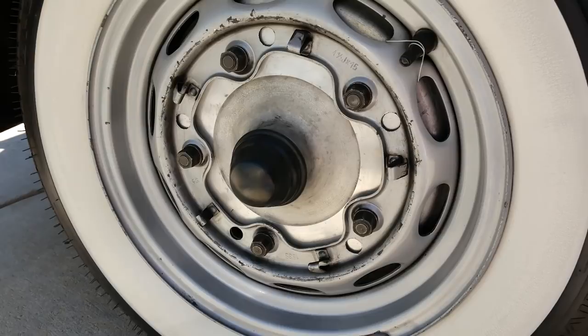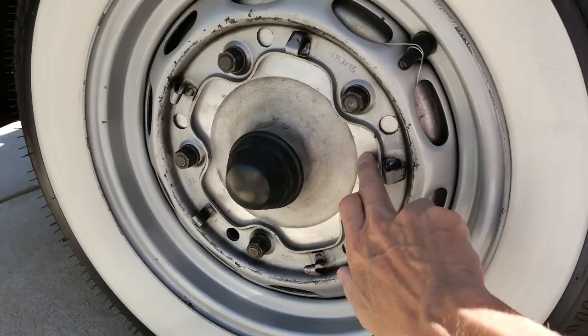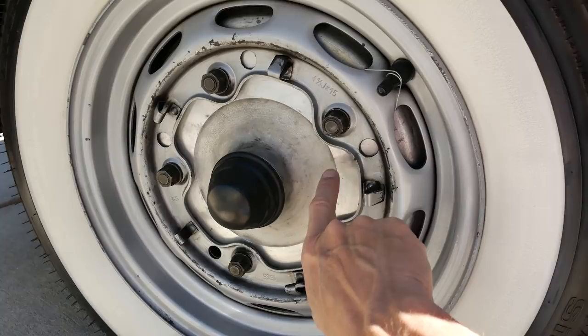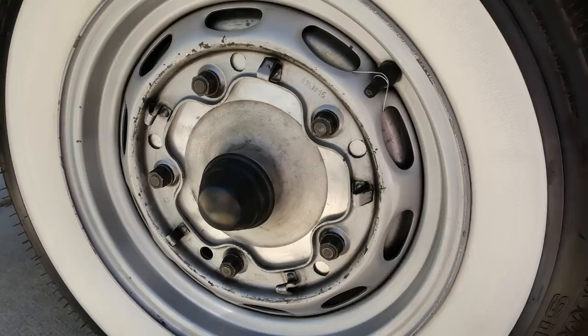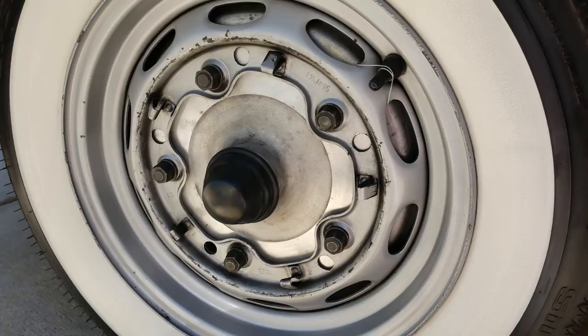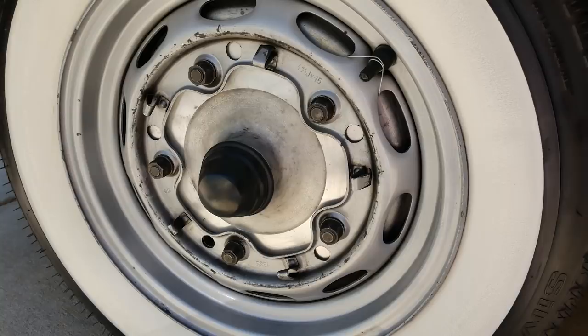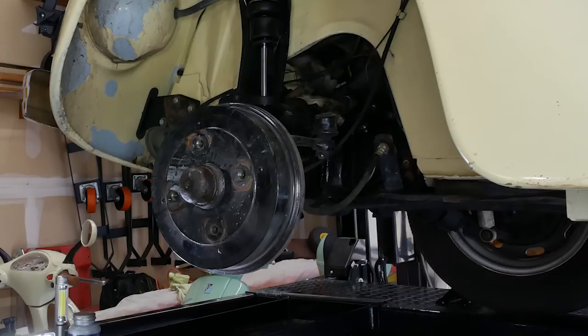With the hubcap off the front wheel we can see the brakes. This drum goes all the way out — it's huge — and it's made out of aluminum. Porsche even cut back the steel of the wheels to reduce mass. We have a five-bolt pattern. The whole concept is to reduce unsprung mass and rolling mass while still allowing quite a bit of brake cooling, so these brakes will have much less fade. On the Beetle we have a four-bolt pattern, and the brakes are quite a bit smaller with the drums made out of steel.